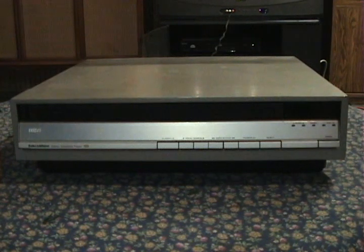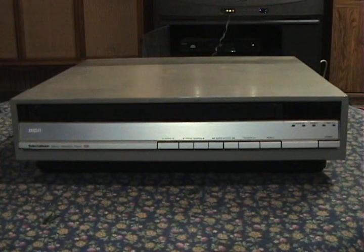You may recognize that I used an SJT 200 in the intro to one of my previous videos showing that it didn't work. This was the first SelectaVision player that I bought, and at the time it didn't work. It wasn't until after I bought a couple more that I decided to open this one up and see if I could figure out what was wrong with it. By that time I had a bunch that didn't work, which means I had some spare needles. It turns out this player actually had six discs jammed inside it — one was all scratched to hell and dirty, cracked in a couple of places, and one of my own discs was in there too. I simply removed all the discs, and the player works perfectly. Let's try it out.